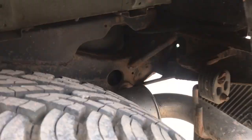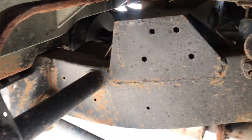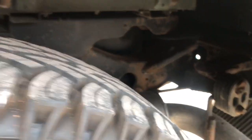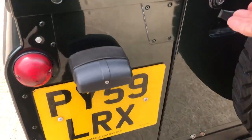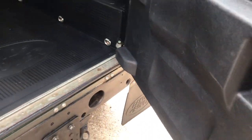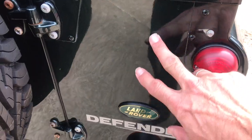Near side rear wing is all rather nice. The chassis hasn't been coated in anything nasty — just a little bit of surface rust here and there, but perfectly acceptable. Around the tail end, no real electrolytic reaction. There's a slight dink on the tailgate. Inside, it's all properly matted out with locating rings. There's also the usual mark where, when you open the tailgate, the spare wheel touches the body.